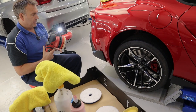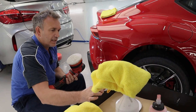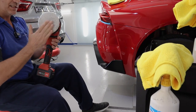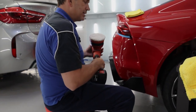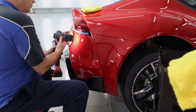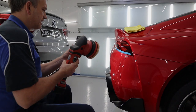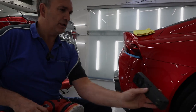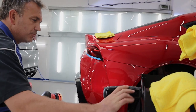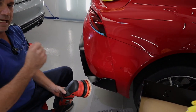So let me go to the Lake Country One Step Pad. It may look like a heavy defect, but that's still a nice heavy cut — so now this pad works perfectly because I need a heavier cut. It's not the heaviest cut — they do two more pads that are even heavier. So I've gone for sort of two-thirds up their scale. If I had a lamp bolted to the side here while polishing — which I see all the time — I can't see anything. So what do I have to do? Put a light on a stall or a trolley like that, a magnet one, turn it at the right angle. I can now see the defects — I can move the trolley, angle the light. If you can't see the defects, how can you fix them?